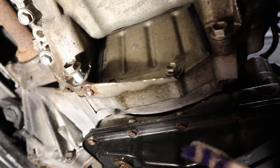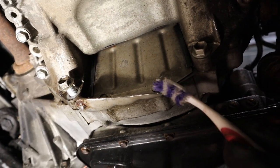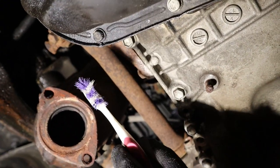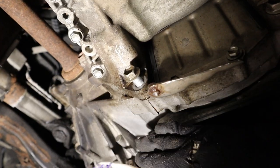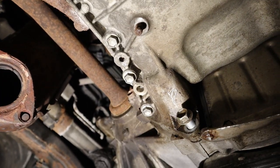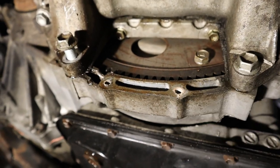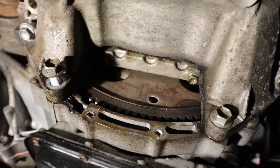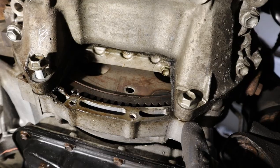Now underneath the vehicle we are going to start disconnecting the engine from the transmission. The first thing is to pull the 10mm bolts and get the cover off. I am not going to try to pull this axle because it is secured to the engine at the back and gets pretty rusty, so I am going to see if I can pull the transmission out the other way instead. With the cover pulled off you can see there is a 14mm bell housing bolt here. All six flex plate bolts to the torque converter are now out. Next I have to work on the bell housing bolts that hold the engine to the transmission.